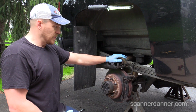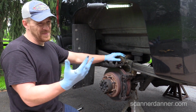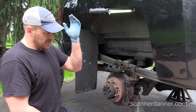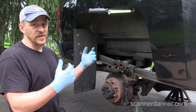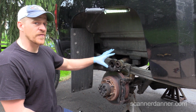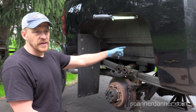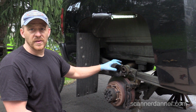Next thing we want to do is I want to check my left front. Well, maybe not next thing. The next parts of this job that I want to do is check the left front, because that one was hot too. But I also want to pull the other ones, in particular the right rear, and make sure that everything's free on that side too. And maybe what we can do, being it's the same piston design, is I can show you the left rear, driver's rear, and see if it reacts differently than this one.